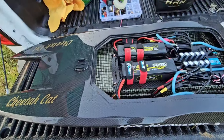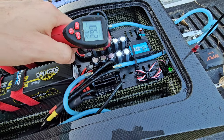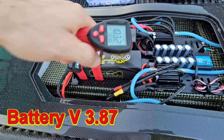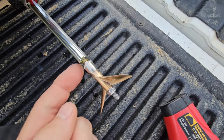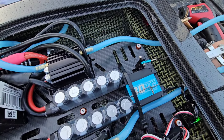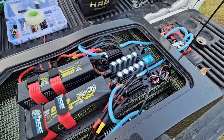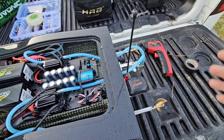Went out and got it, brought it back in. Everything looks kind of okay. Capacitor temps: 106, 105. ESC: 116, 113 — wow, that's crazy. 103, 103, 100. We got 67 miles an hour out of it. I feel like we stripped this plastic servo arm — I need to go ahead and update that to a metal one. I'm going to pop it off, pop the batteries out, and replace it back. It definitely slipped and adjusted the angle of my rudder.